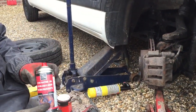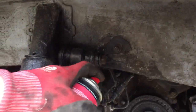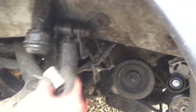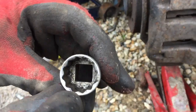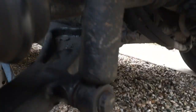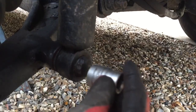You need some penetrating oil for definite. The bolt at the top there is 18mm. There's a bolt at the bottom - you see these sockets I'm using? They've got like a star shape. You must use this type, especially on the bottom there, because you'll see it is that type. And that is a 21mm - that's really crucial.